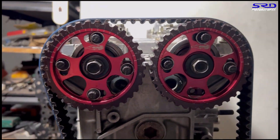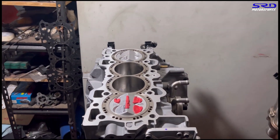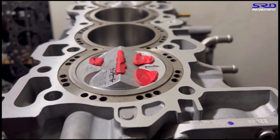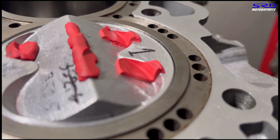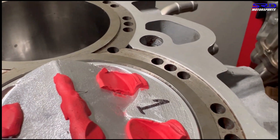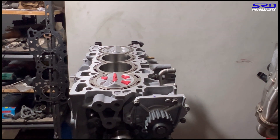We remove the head and check the clay results — this is exciting. There you go — it's still quite safe, even on the exhaust side, and with no spark plug it's safe. We cut the clay in half to actually see how thick it is. Even at plus three on the intake it's still safe — it could still go to plus four, but we won't even reach plus three on the dyno; we'll be making power well before that. So we have a safety window: good until plus three on the intake and plus seven on the exhaust, with valve-to-valve at least four degrees apart.